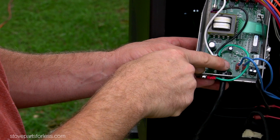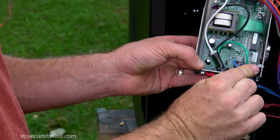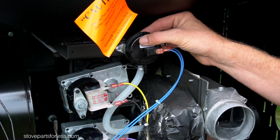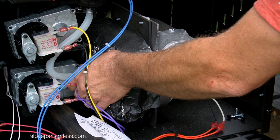See how I just put it on there — right there. If you put it on those pins, it jumps these two blue wires together. This is relevant if you're getting an E1 or E2 error code.